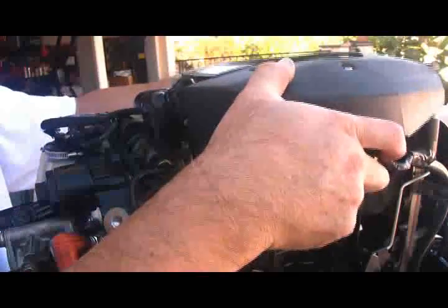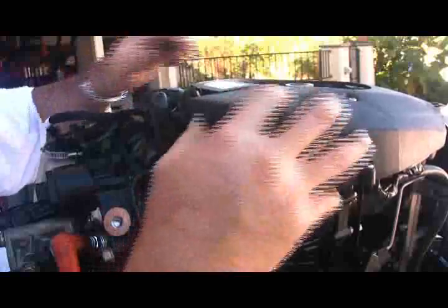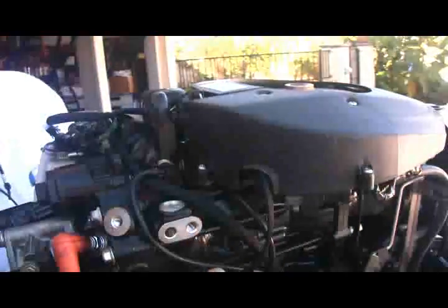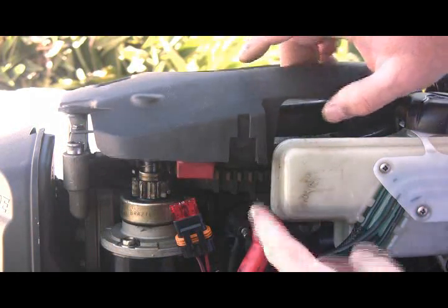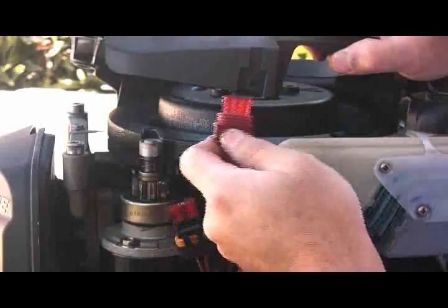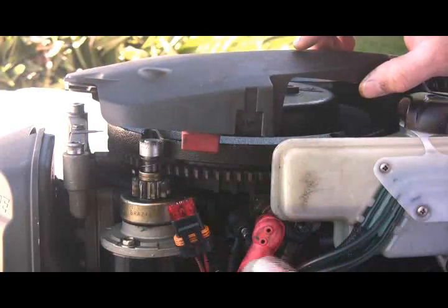It's a little bit tight under the hood. To try and put the cover back on while the engine's running is obviously not something you'd want to attempt. I think once we get the motor started with a rope pull, I'd just press the cover on and leave the little rubber grommet out of the picture until I get home — you don't want to get your fingers back there. Also, underneath the flywheel cover there's a spare fuse holder. You want to make sure you don't lose that either when you take the flywheel cover off. It's pretty snug, but it can pop out and it's not something you want to lose in the water.